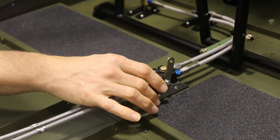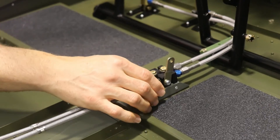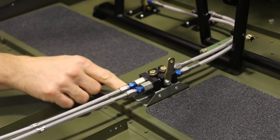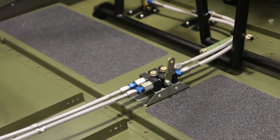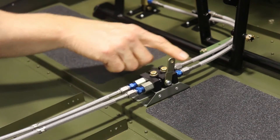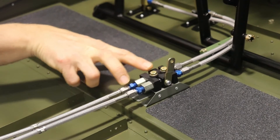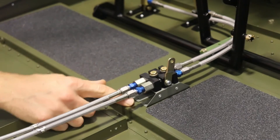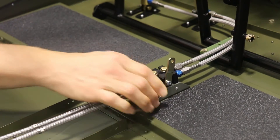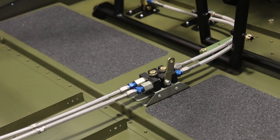The parking brake valve is off-center — not centered in the middle — and that's intentional. There's a fuel line that runs forward here and gets clamped on this side of the nylon bushing going up to the firewall, so having this off-center leaves room for that fuel line. I also don't have the valve secured down yet, because no matter what mount you design, if you start at the back and connect your bulkhead fittings then connect your brake lines, everything will position itself perfectly. At that point you just drill the holes and rivet it to the floor.